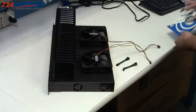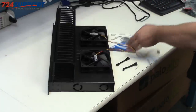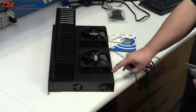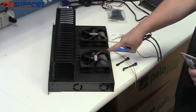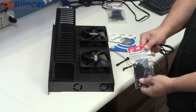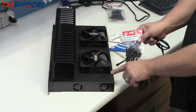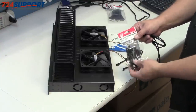A pair of 120 fans is what we're going to use. You'll need a pair of fan grills so nobody sticks their finger in, and there's another trick with those, probably some cable ties. And because we're going to be attaching it through to the inside, you want to make sure there's nothing but insulated rubber that's penetrating the top. So we're going to use rubber fan screws, siliconized rubber universal fan pins from Akasa in this case. They'll come out and up, and all that will be left inside will be a tiny little piece of rubber.